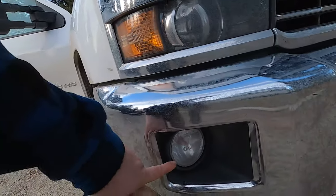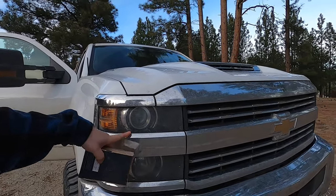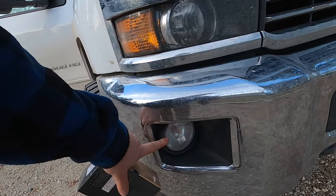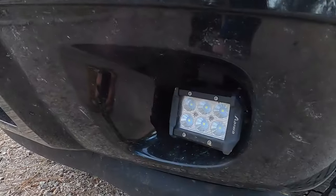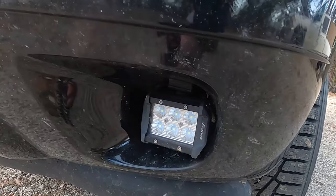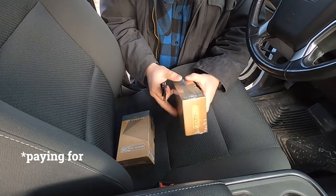The color of these fog light LEDs is about 5,700K and the Morimotos are about 6,000K, so they're not that far off, but if you're perceptive you will notice a difference. I didn't want to put LED cubes in here like I did in the other truck — I like the stock look, though I would if I change this bumper one day. I'm running cheap cubes in the Tahoe and they seem to work well — been working well for about three years now.